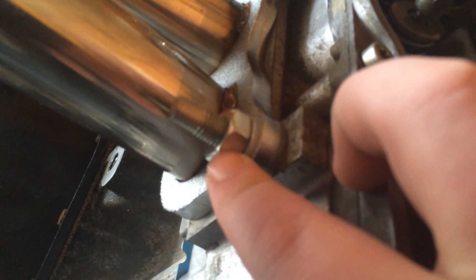This is not the factory washer either — the nut and washer are I believe one piece from the factory. These are just some heavy-duty M10 washers that I got from AutoZone, and these are also some heavy-duty M10 by 1.25 nuts from AutoZone. These studs are factory Subaru studs, they were like $2 a piece — I ordered them a while ago, they were actually one of the first things I ordered.